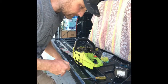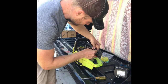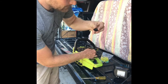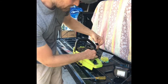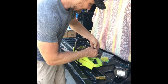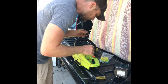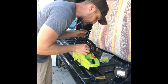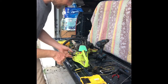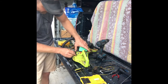I'm probably going to need some little pliers to pull the lines off the bulb — oh, that one came off pretty easy. You just have to match these lines up so they go back on the same way. You can tell because one is just a little bit longer than the other, same as on the old bulb, so just match them up and stick them right back on. One of my lines just dropped down through there, so I had to fish that out. Got it connected — now I've got both fuel lines connected to the primer bulb. I'm going to stick it back in and screw it in and see what happens.